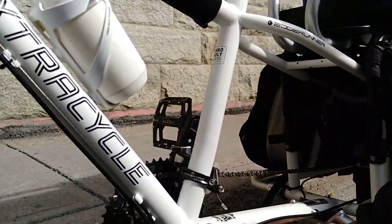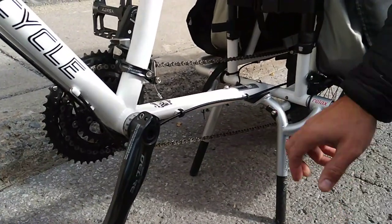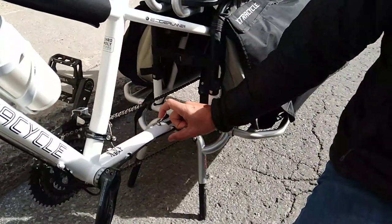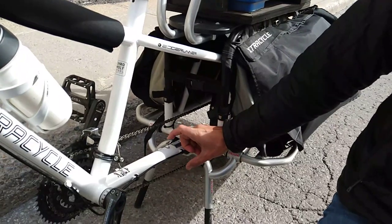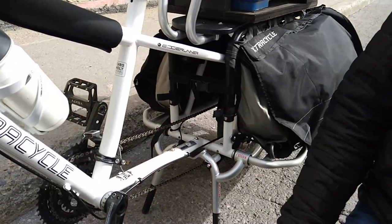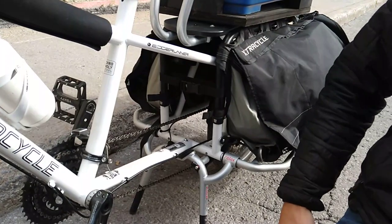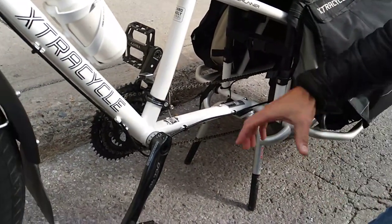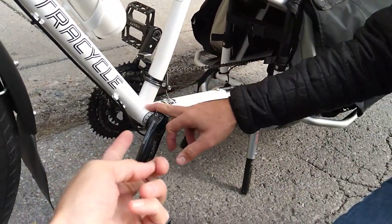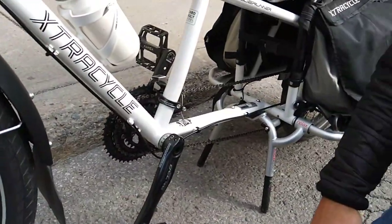You could put a bottle right here, or something like a tool pack. And they sell — if you want to add a motor — a little bracket where you put the battery actually right here. They sell an off-center CNC bracket so the battery would be here, which would be perfect for keeping all that weight low. You don't want a battery up high. For a hub motor or a mid-drive — whatever you set up — your big like 10-pound battery, you could electrify it with a mid-drive motor, do a BBS, you could do a rear hub, you could do a front hub. Options are plentiful.